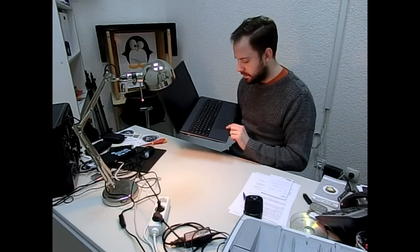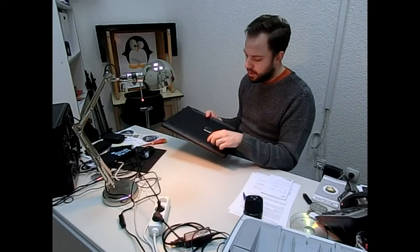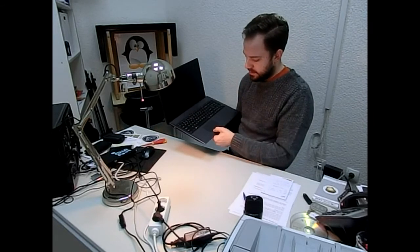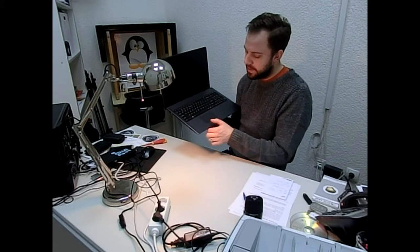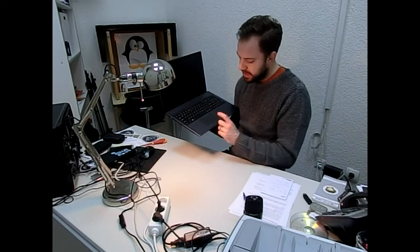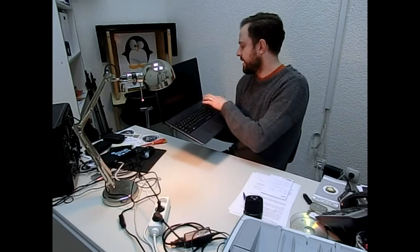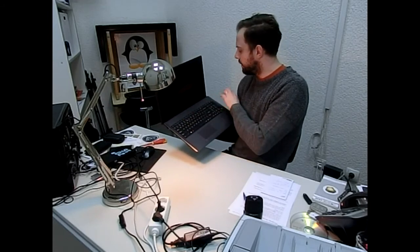It feels really cheap. So what I did is I opened up the back, which is really simple. I'll show you later. Open up the back and put some cloth or some material between the plastic and the open space, so it muffled the clicking sound a little bit and made the force that's pushed against my press a little bit tighter, so I can press harder on the mouse clicking thing and it doesn't feel so cheap anymore. I didn't do this with the power button because I don't use the power button that much, so I don't mind.